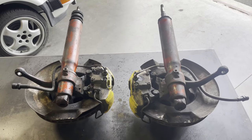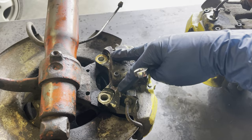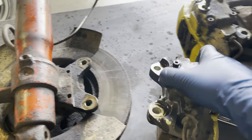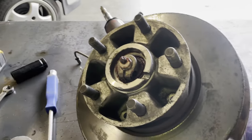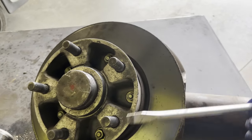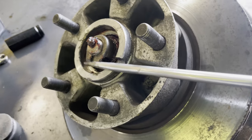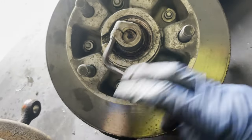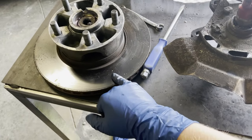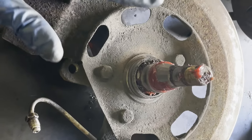These assemblies are up next — I'm going to separate everything. I removed the brake line with my 11mm brake line wrench and removed the two bolts with a 19mm impact, so the caliper should slide right off. Next, pop this cap off using a screwdriver — come up under the lip and give it a whack, spin it, repeat, and eventually the cap pops right out. Then rotate to align with the allen wrench, loosen it, and the whole hub assembly should slide off. After sliding off the hub assembly, come in and remove these bolts with a 13mm to separate the rotor from the aluminum piece — then sandblast and clean it up. I'll also remove these three bolts to get the dust shield off so we can sandblast and paint it.